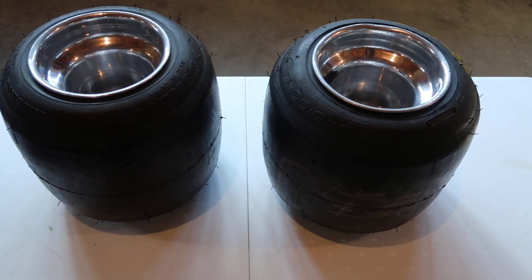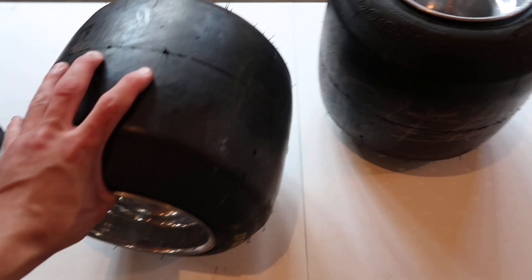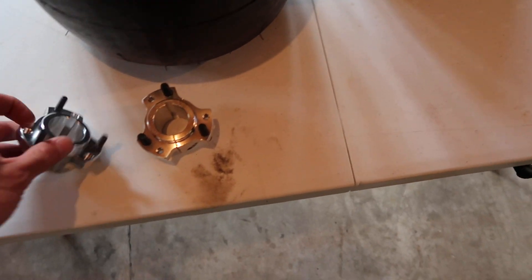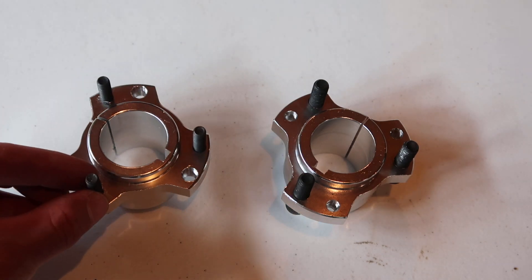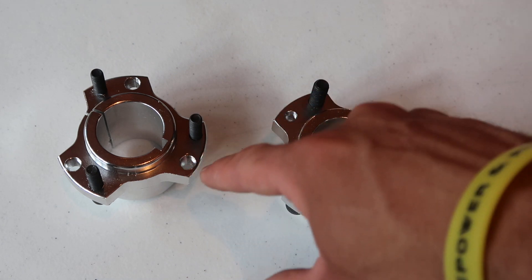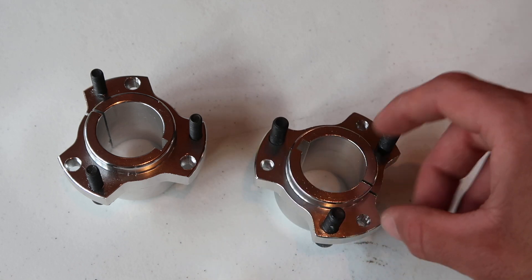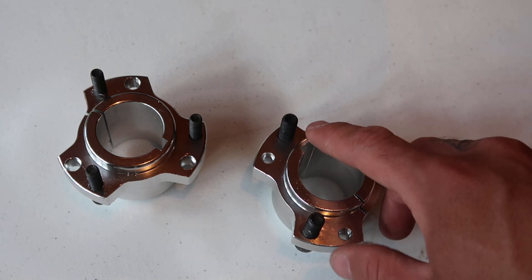I have my rear wheels and tires that came in. They're basic go-kart rear wheels and tires. They have brand new Dunlop slicks on them and I got my drive hubs for that as well. These are the hubs that came with the wheels. They are standard inch and a quarter bore go-kart hubs. They came with quarter-28 hardware like the one on the left has, and they are also drilled for 5/16-24, which is what I put on the one on the right side. I had to go buy this hardware and I'll show you why.